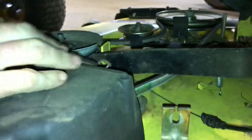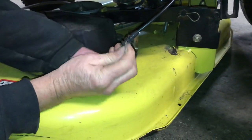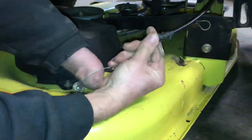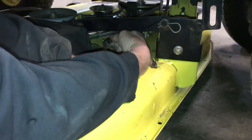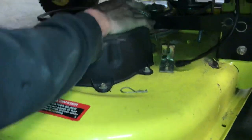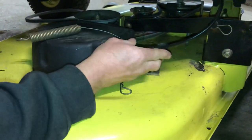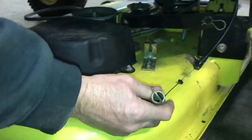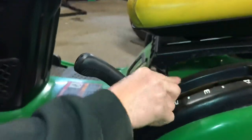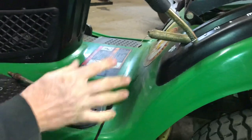Make sure you find where the opening is so you can pull the spring out of the hole on the arm — that's the blade engagement right there, that's what engages your blades. Get the spring out and you can pull this out. It has a hole that the pin goes in. On the other side it's a little tricky to get on, but what I do is put everything together, engage the mower deck blade, and then it makes it easier to find the hole in the back because everything's taut. Put this out of the way so you don't drive over it.